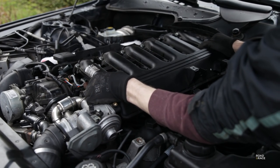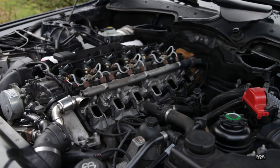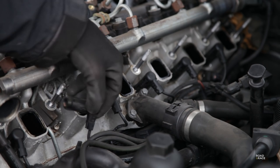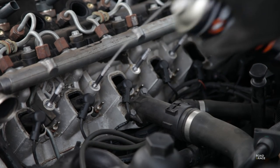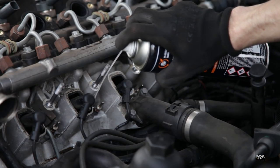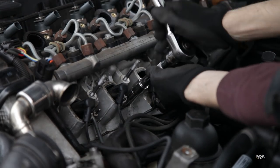And after all that, it's the immense satisfaction of lifting out the entire intake manifold. Next up, these connectors need disconnecting. Now you really do not want your glow plugs snapping in the cylinder, because it's just going to be all kinds of pain. So I would highly advise using as much penetrating fluid as possible, then very gently try easing the glow plug out.